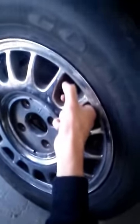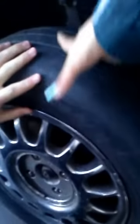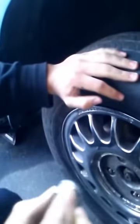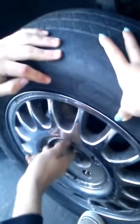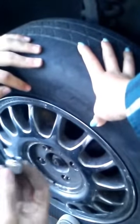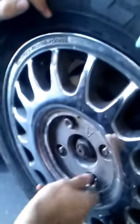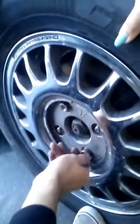Just lift the tire up — it's pretty heavy, so if you have anyone else in the car it would be nice to have them help you. Hold the tire while you're putting the nuts on; this side goes in. Make sure when you tighten them you use your fingers at first. Something important: put the nuts on across from each other so the tire will be evenly seated — if you go side to side, one side can be higher than the other and it'll look lopsided.